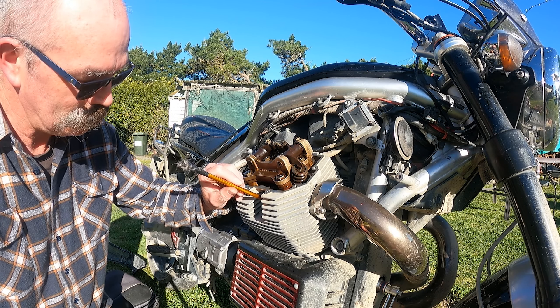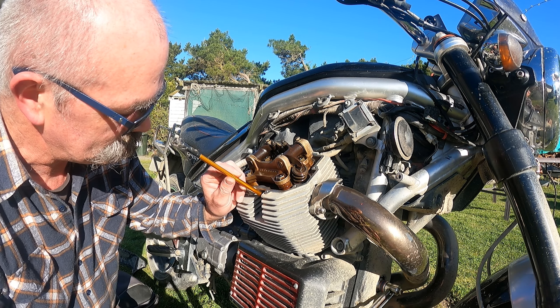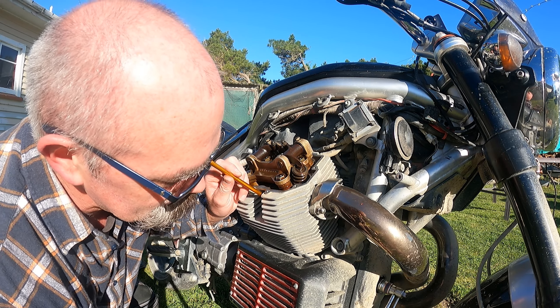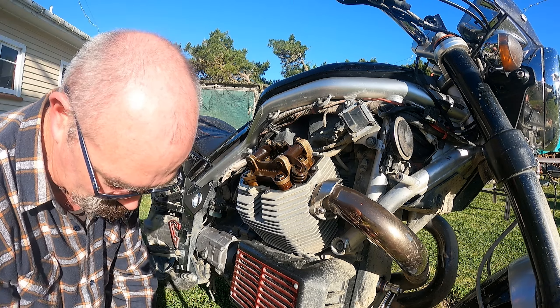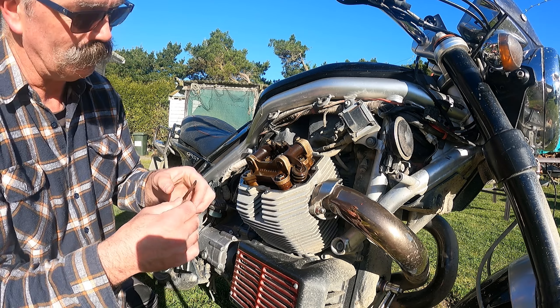This is just an aluminium template and we're just going to turn the engine around until we reach the very top — being very gentle, don't go stabbing the top of your piston with anything stupid. Now with the right side, we're looking at 0.1, so you need a set of feeler gauges. 0.15 should be our exhaust.